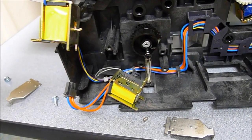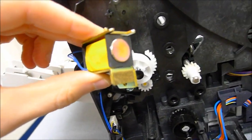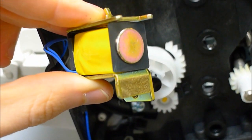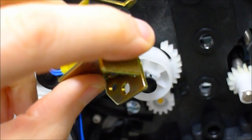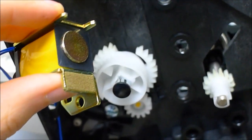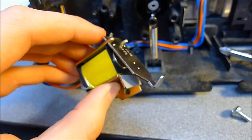Even though it doesn't have to be done, I've also removed the tray one and tray two solenoids as well to prepare to clean them. You can see how much crud is on there — that brown patch there is on all the solenoids and that's what you need to remove because it gets really sticky with use. It doesn't feel as bad as the duplexer one was, but that is the main cause of the sticking issue. So we'll get those cleaned off and hopefully things will work a little better.